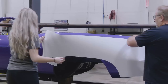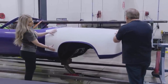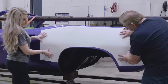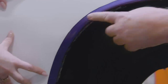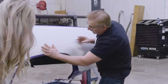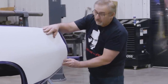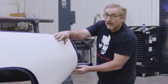The first thing we're going to do is set the decal up there, seeing where everything lines up before we get it wet or start taking the backing paper off. You never want to put a graphic on paint with the backing paper without making sure the surface is clean — otherwise you put a scratch in there or a dirt nib falls under your graphics. Just tack cloth the area first. We're going to set it up there and get an idea about what we like the looks of.